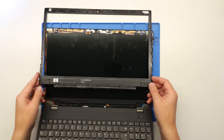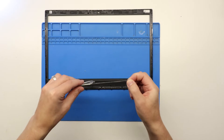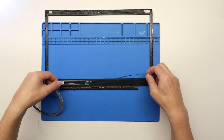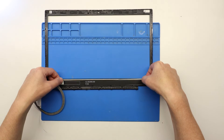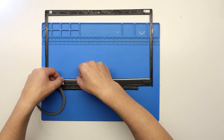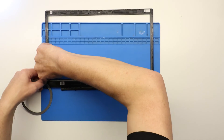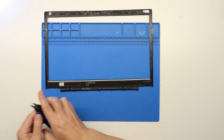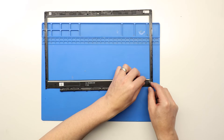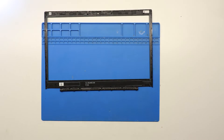For the side bits the actual adhesive is quite good already. Let's just move the laptop out of the way and come in with this thinner double-sided tape — the kind you see on eBay, very readily available. I'm just going to put a new strip along here just to make sure the bottom of the bezel sticks down nicely, because some of this glue that's already on there doesn't feel as tacky as it should. Cut it off there. Then obviously remove the other side of the tape, and come back in with the laptop.